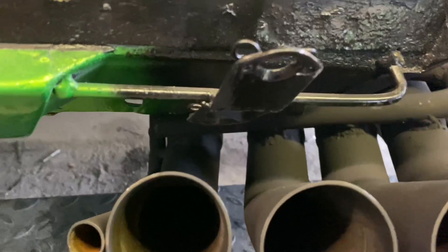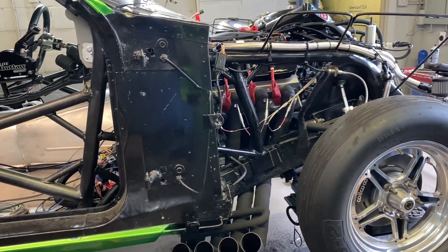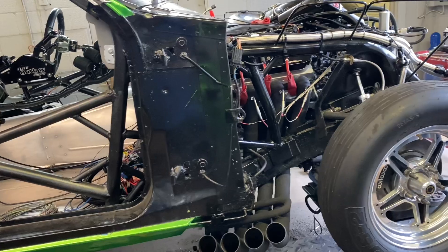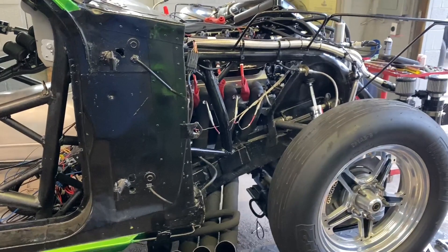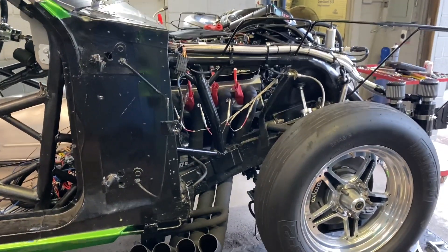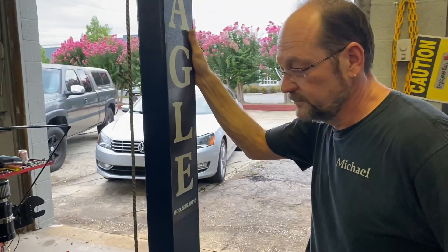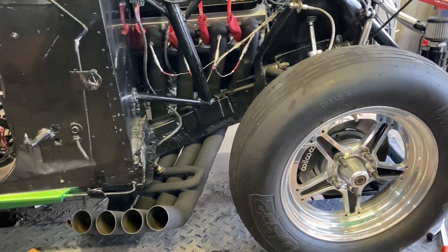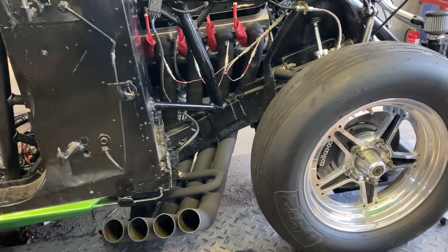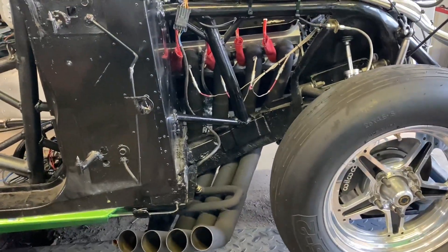It runs, it's just not running good, which usually means there's an alignment issue. You might remember when we were at Dig or Die with Happy's car — we got his cranked up and it has a regular MSD 4-magnet wheel on it. It flat kicked my tail. It took me forever to get it where it needed to be. Hopefully this will be easier since it's essentially a 12-minus-1, so 11 magnets with one missing.